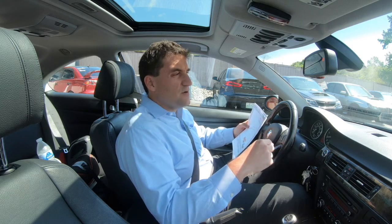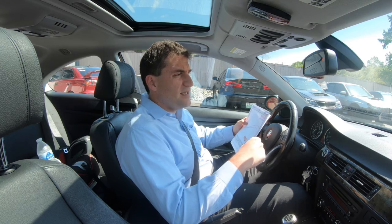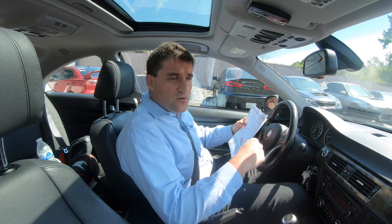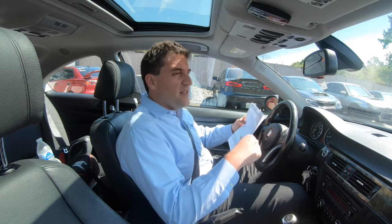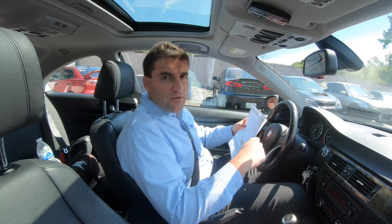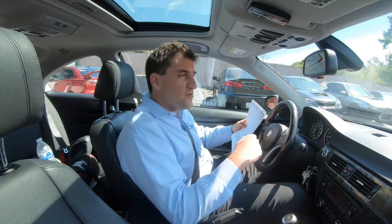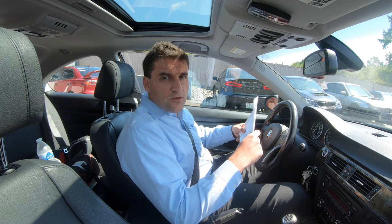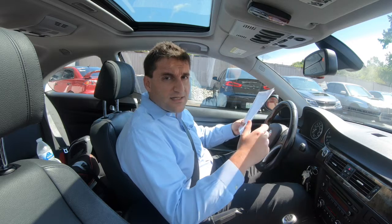As I mentioned in my previous video as well, the dyno machine where I tested this car is conservative. So in comparison to a dyno jet machine, which is the one most often used, it usually shows figures that are about 20% less than what you would get on a dyno jet. So to get at the dyno jet numbers, you need to apply an additional 20%. If we did that to the 234 horsepower stock, we were already producing about 269 horsepower.